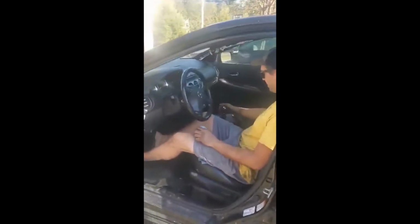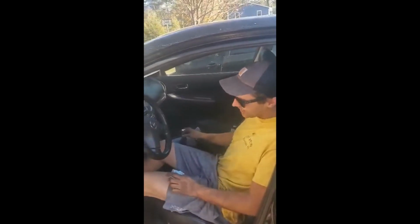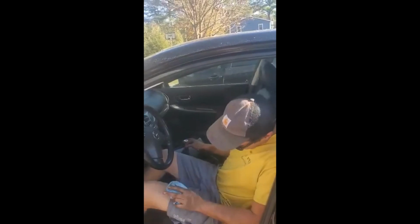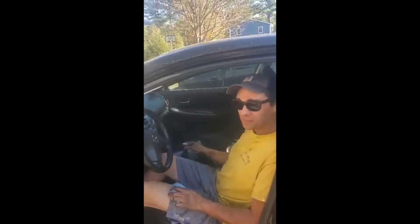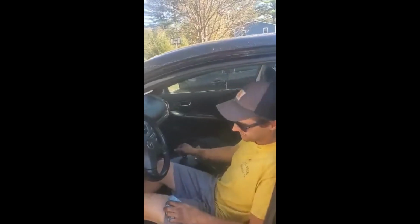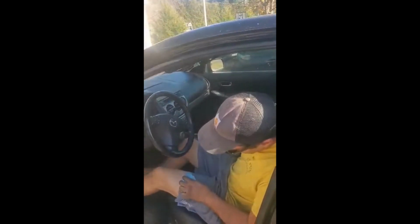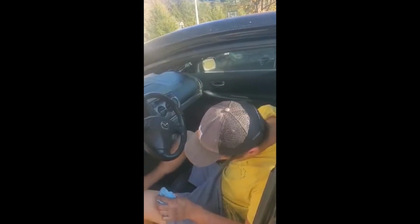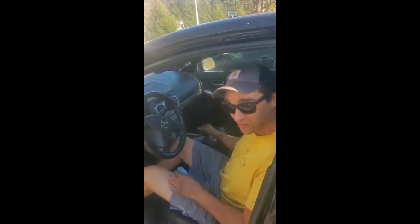Test number 1. Boys, she's shifting every gear, no problem. Reverse. All right, now see how the clutch feels. Okay, clutch went right to the floor. Has not returned yet. Might just need to get pumped up a couple times. Yeah, that ain't quite right. There you go. Haha, boys, see it? Oh, that was like a little heart attack.